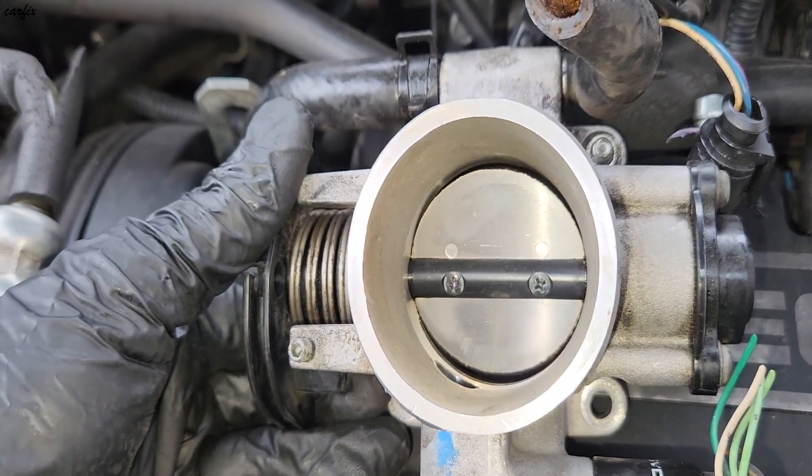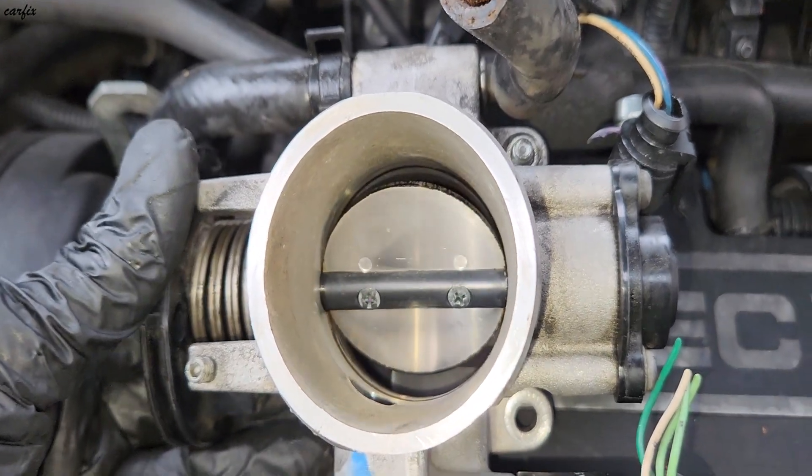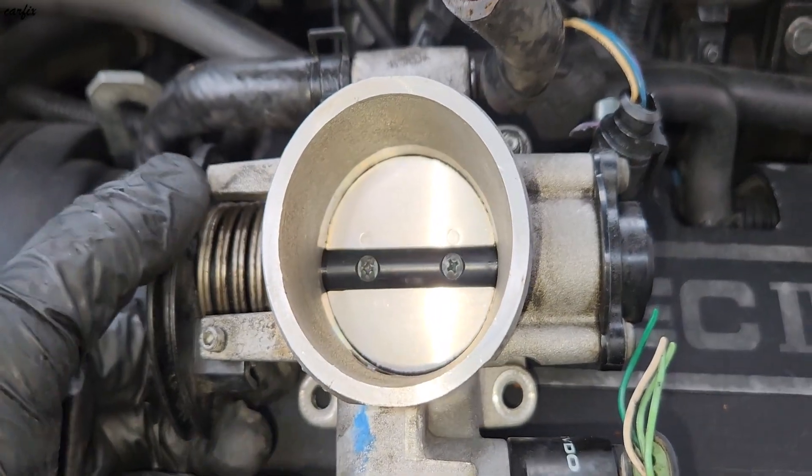You can see this sensor reads how much the throttle is open. It's a bit open right now, so the RPM is fluctuating — a lot of air is going inside. The throttle should be fully closed, like this.